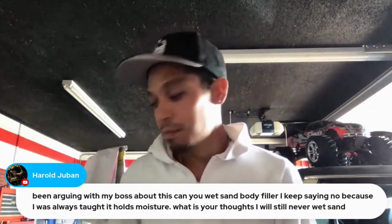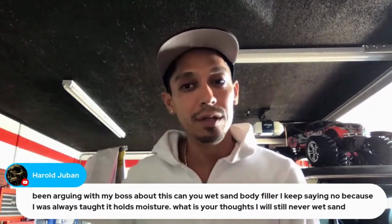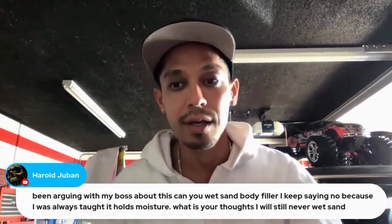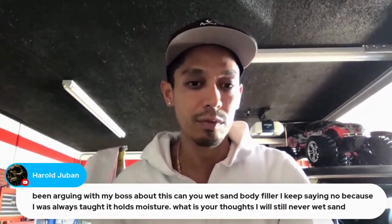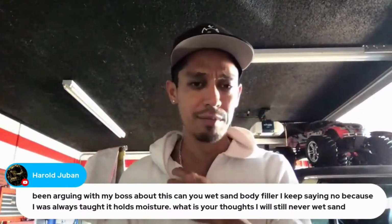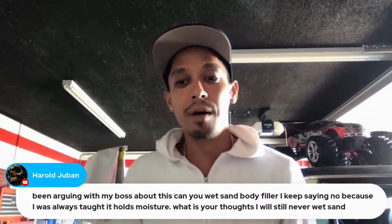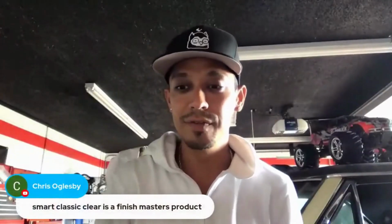I've never basically rough coated body filler, finished it off with 150 or 320 grit and then wet sanded it like that. I've never done that. Yeah, you're not supposed to do that. So I'm not sure, Harold, what's going on with your boss or what type of wet sanding you're doing on body filler, but it's not normal just to wet sand body filler. If you're cutting through primer, wet sanding, and you get to it, that's fine. That's normal. It's not going to hurt it. Let me know if that answered your question.